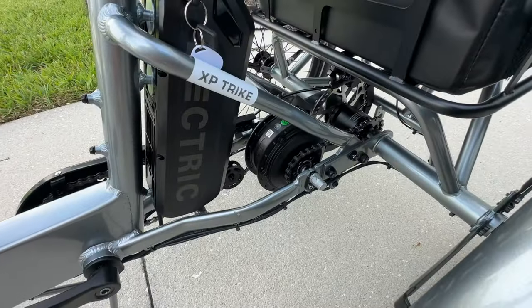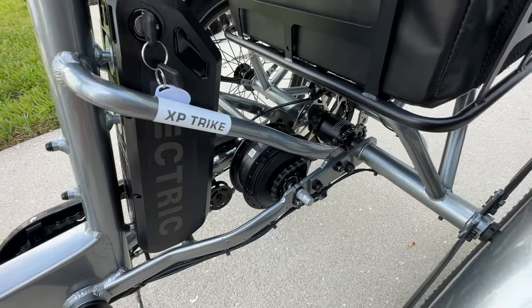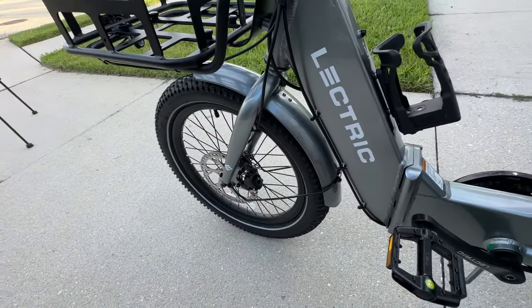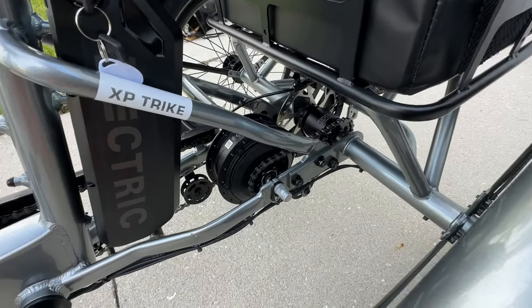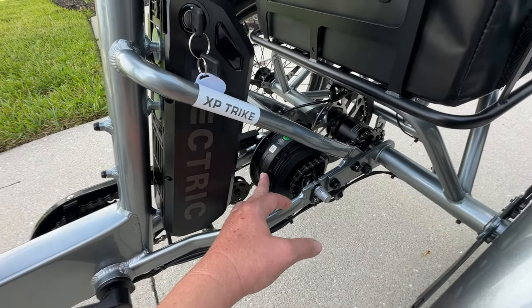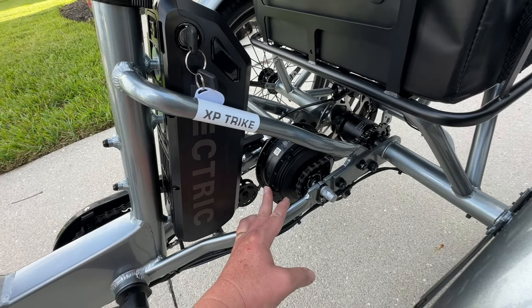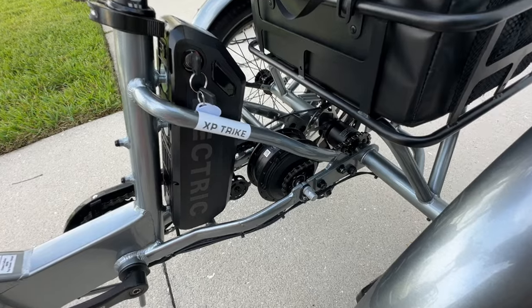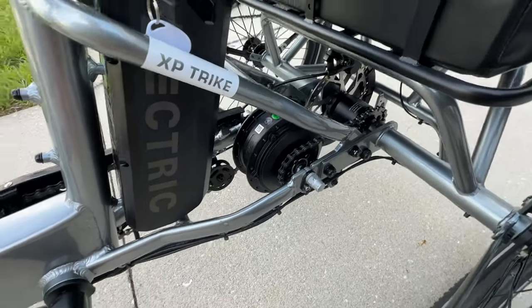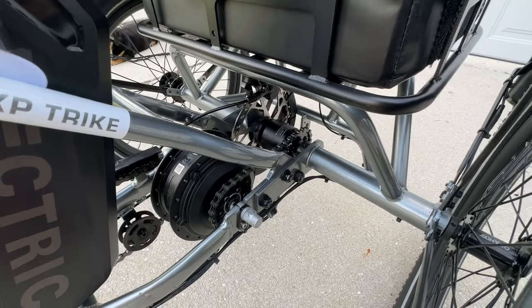Let's talk about the motor for a second because it's quite unique. For a trike, most have motors on the front hub, but Electric decided to put this one on the rear. I think that's very important — it really helps the ride and prevents the tire spin-out you often see with front-hub trikes. They took what looks like a standard hub motor and mounted it back there, and it works well. It's a 500 watt motor, but it's far more powerful than we imagined — it peaks at around 1,000 watts. It's a unique design with a chain on each side running directly to the axle. It's a differential axle, which I think is a must for trikes — they did a good job with that.